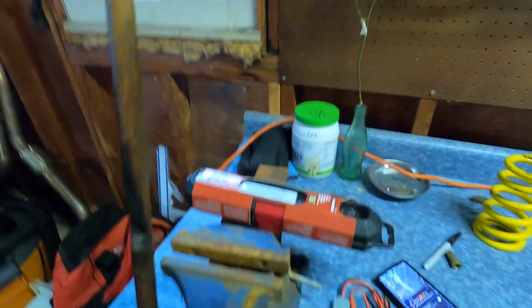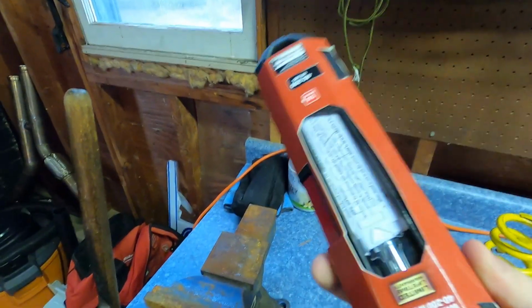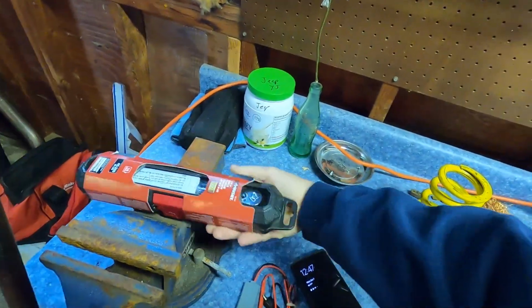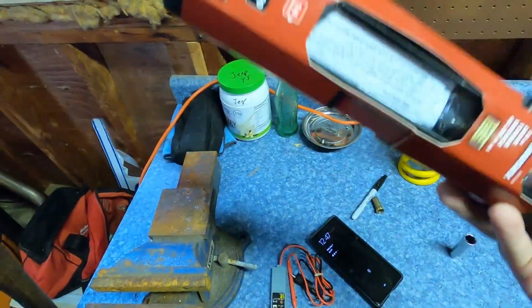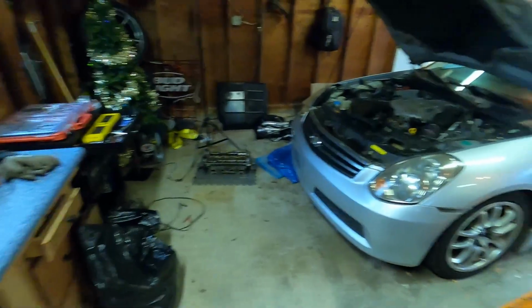So I went out and bought a smaller one because they just need 7 pounds, which can be converted into inches. So this goes 40 to 200 inch-pounds, and 7 foot-pounds converted into inch-pounds is 12 times 7, or 84. So I went to go torque it down with this. I literally bought this brand new Husky garbage. Doesn't work. Same issue. Tested it out on other vehicles, different bolts and everything.